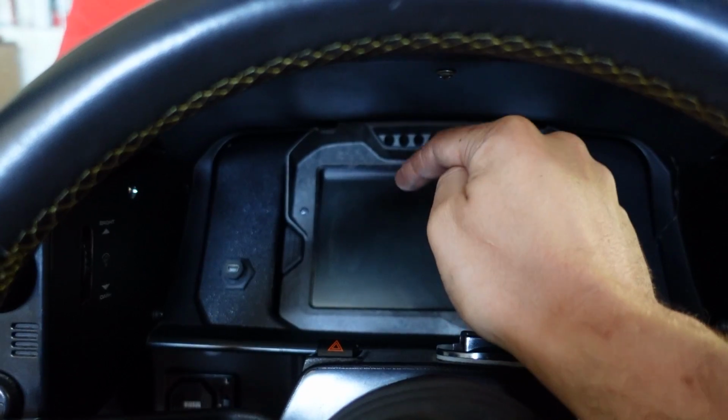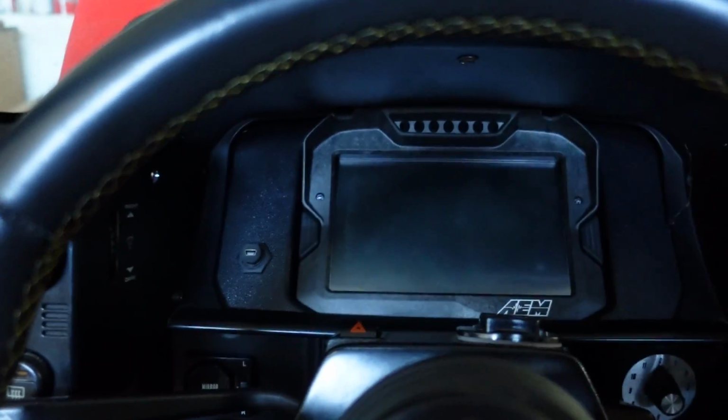This thing helped me notice a very major problem that I had while tuning the ECU and tuning everything to run right. I had configured my map sensor improperly. You have to configure your input for the map sensor, basically the map sensor resolution. And I thought I had a 2-bar sensor, but it was actually a 3.5-bar sensor.